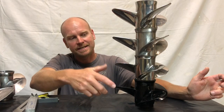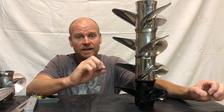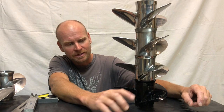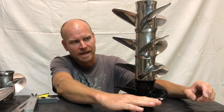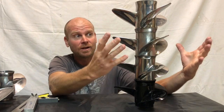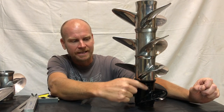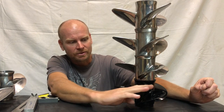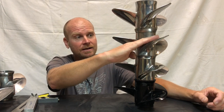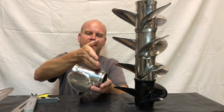These propellers here are all for the same motor. These four here are actually all 11 pitch, so they're the same pitch. But it's interesting when you look at them because you can see these bottom two — the angle of the blades looks a lot less than these top two, and yet they're still all 11 pitch. The reason for that is the rake angle, the angle in here. These bottom two, the blades are quite a low rake angle, and these top two the blades are connected to the hub with more of an angle.